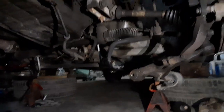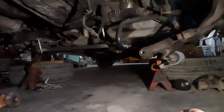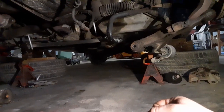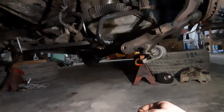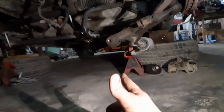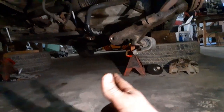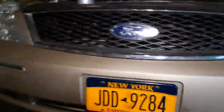We're gonna have a dead battery here in a minute. That's what it looks like — you gotta take the exhaust off, take the rack off, take all the motor mounts off, take the sway bar off. The sway bar is really hard to get at, but if you take the subframe down a few inches and get everything except the sway bar loose, you can let the backside settle down a few inches and then you can get at it.